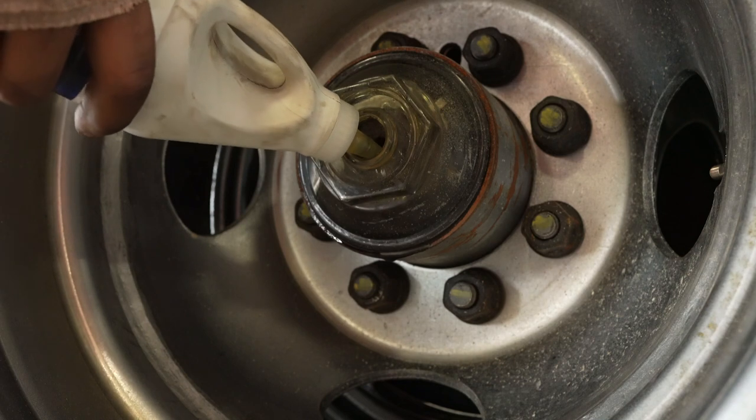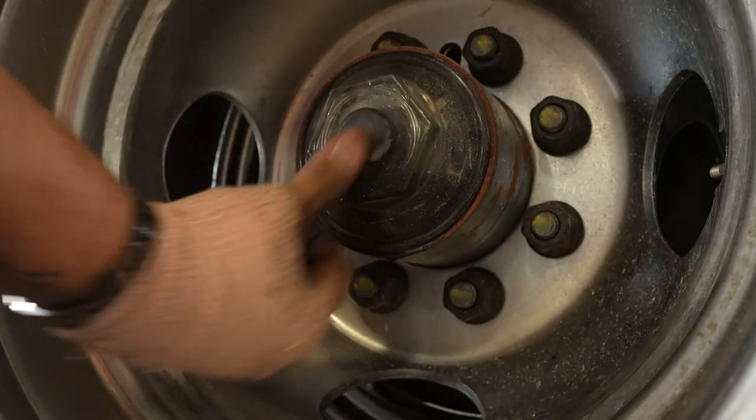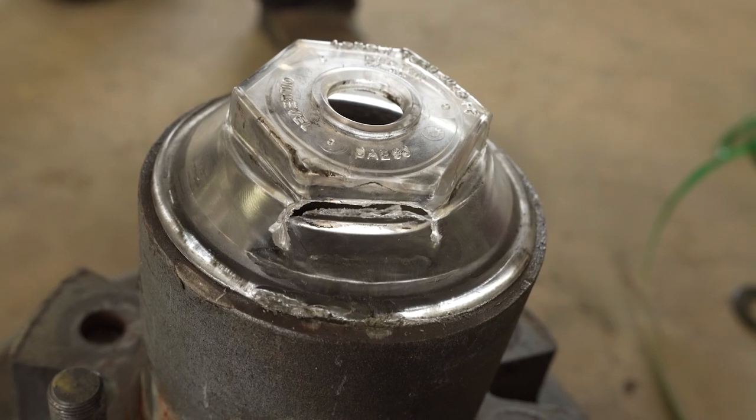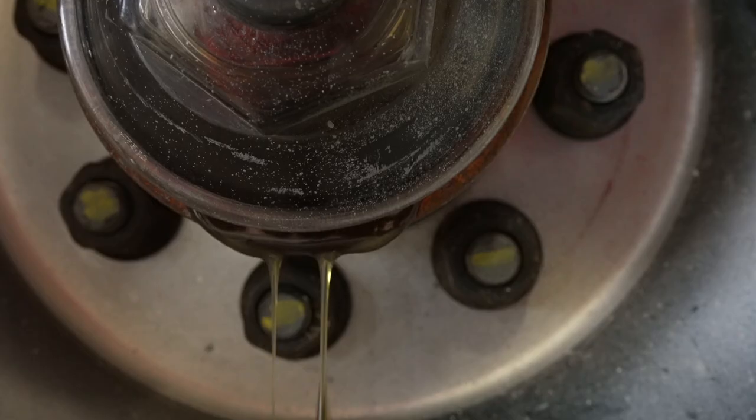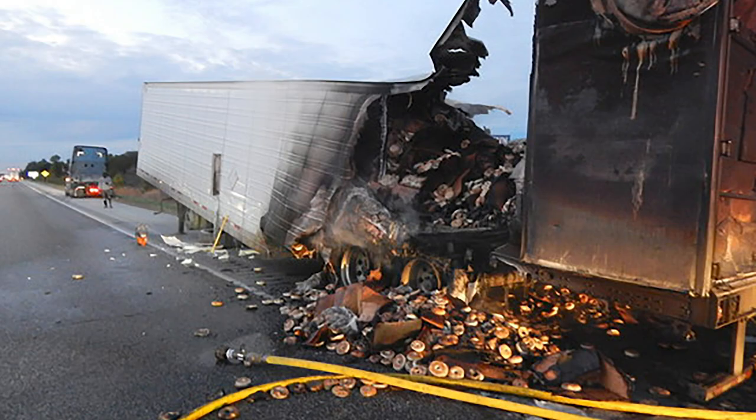They work great, and it's very easy to change the oil, but the downsides can be horrendous. There are two big things to watch out for with oil bath axles. If your oil bath cap — the part of your axle where you can see how much oil is on the inside — breaks while driving, it can be very, very bad. Same if you blow out one of the seals. Oil is flammable, and when you introduce friction, the heat can actually ignite the oil from your axle. Plus that oil gets all over the place, expanding the area that is now flammable.